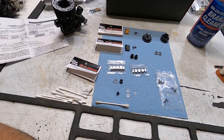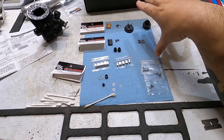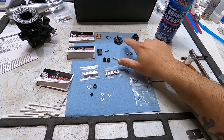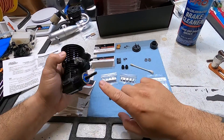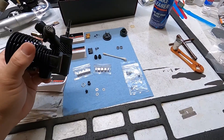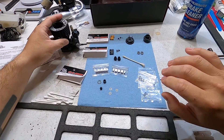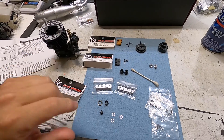Something I didn't show but I do on every clutch build regardless is clean everything off. I want to make sure any machine oil that was used has been removed. This Q-tip's kind of dirty — I ran it through the clutch nut I'm going to use, along the flywheel, which had some machine oil on it, and inside the clutch bell. On the crankshaft I clean the threads. I'm using brake cleaner and a microfiber to clean. You also want to clean all the oil off the front of the bearing — if there's any oil on there, it'll get into your clutch and cause wear issues where the clutch won't properly bed in and will be inconsistent.